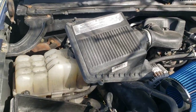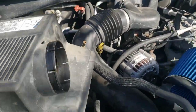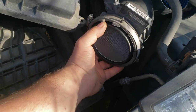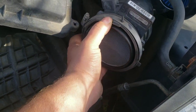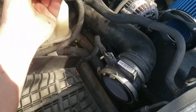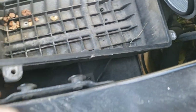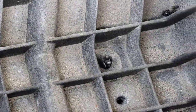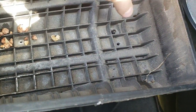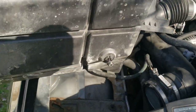I took out the four bolts on each corner and popped it off. It's situated around your mass airflow sensor, but under this rubber you've got to loosen your hose clamp. I moved this out of the way to check for any bolts holding it down — there are none. You should just have these little plastic clips, one there and one there. You can squeeze them with pliers to compress them and then pop the box off.